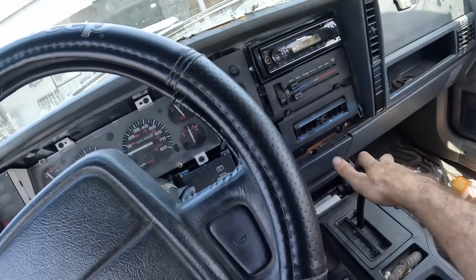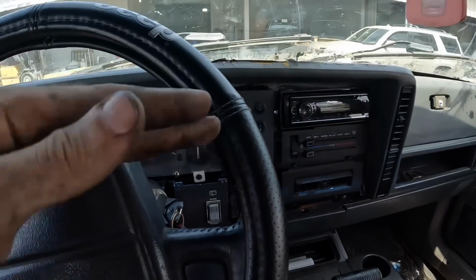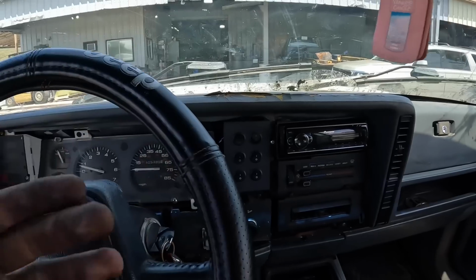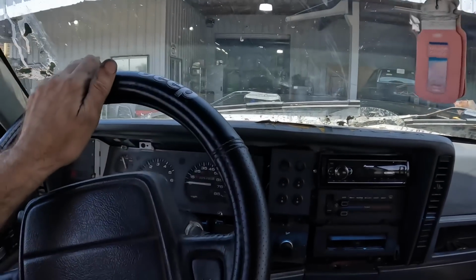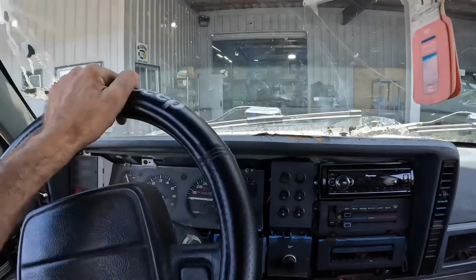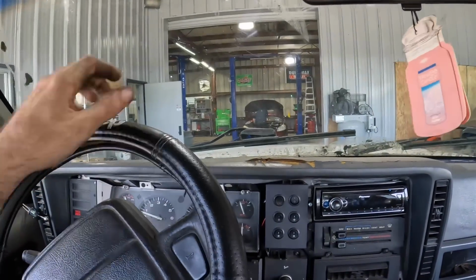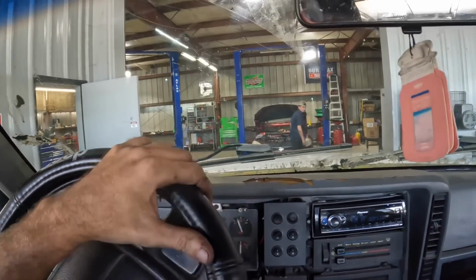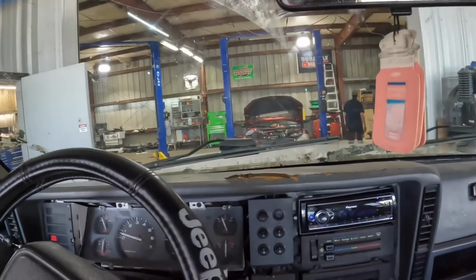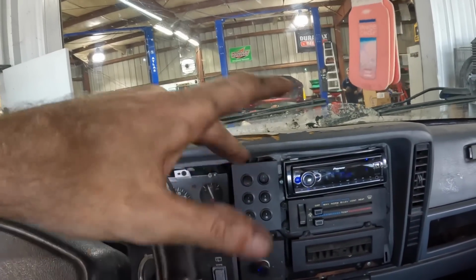It's been driven twice today, so I think, yeah, it has reverse now. But Troy tells me in the mornings he's got to rev it to the moon, and then the transmission will catch up and it'll slam into reverse gear, and then he can back down his driveway. So before we put a junkyard transmission in it or something like that, I'm gonna get this on the lift and we're gonna pull the pan down and just see what's going on inside. I'm wondering if it's just got a bunch of crap and debris and floating nonsense in the pan.